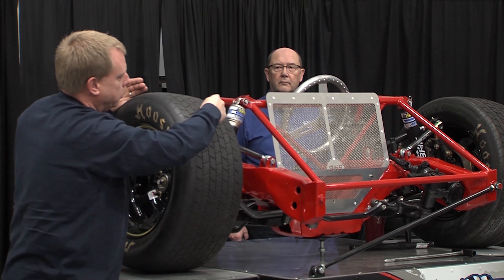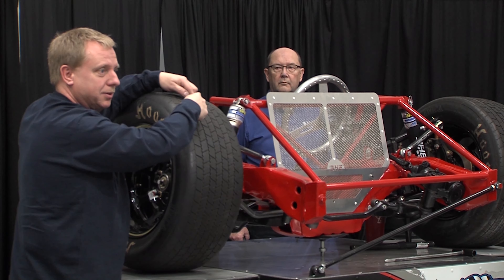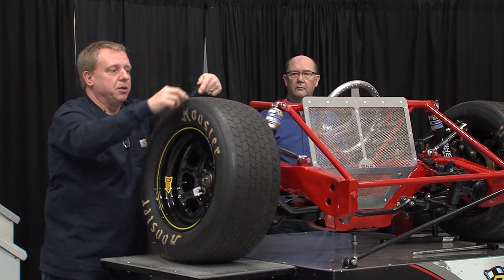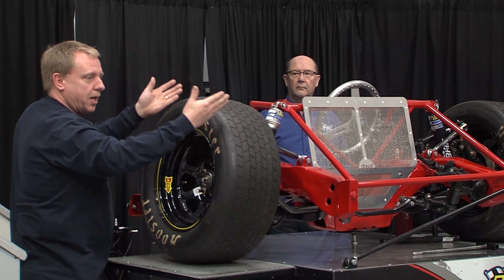I watch people ruin brand new tires. If you have a real aggressive pad and stand on the wrong side, you're knocking off your sharp edge on the front and your sharp edge on the outside. So stand on the beadlock side on a right rear.